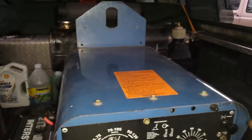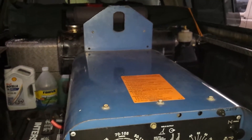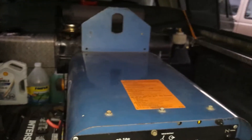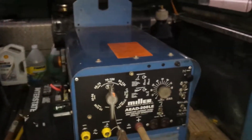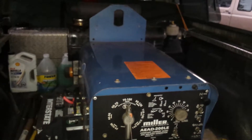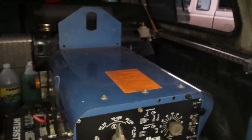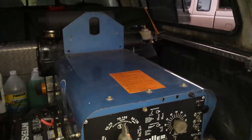It would need maybe an adjustment on points or a set of points — that was like every five to eight years before you needed to put points in and a condenser. Well, I did that, but I hadn't put points in it that long ago, so that didn't fix it. The plugs are coming out sooty, like it has an ignition problem. I put in a set of wires — I couldn't get any continuity through the spark plug caps through the wire conductor, and they were solid core wires. That didn't help it.